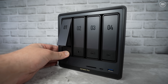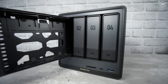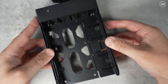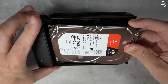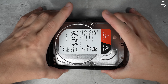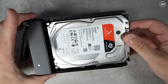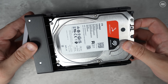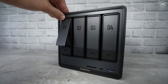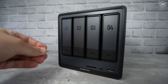Removing the cartridges is super simple and you do not need any tools. To secure a drive, each cage can extend and then you just place the drive in, lining up the little dimples with where you would normally attach the mounting screws. You can then close the cage and it's ready to be inserted back into the NAS. If you have four drives, just do it for all four. I've got two drives here, each four terabytes.